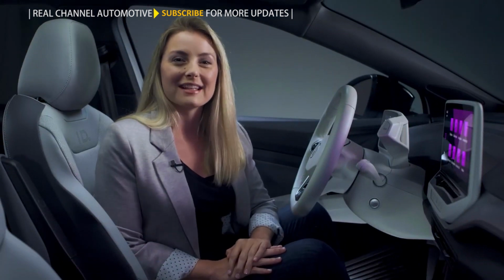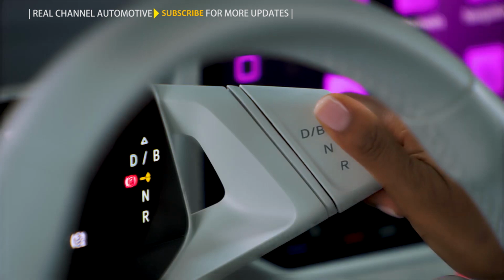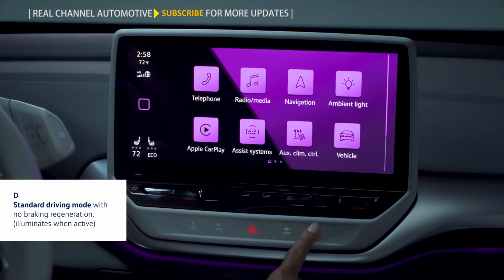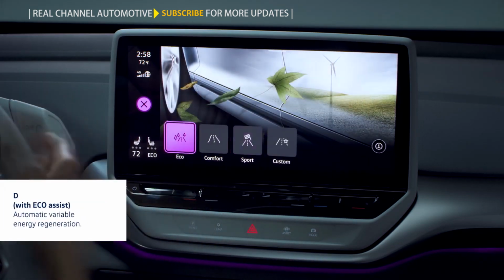An important feature is the regenerative braking mode. There are 2 forward gears, D and B. Turning the drive selector once to the D position is the standard driving mode. No braking regeneration will occur unless the Eco mode is selected in the infotainment system.